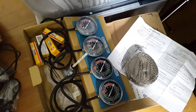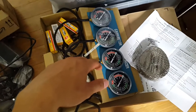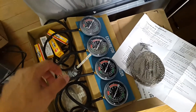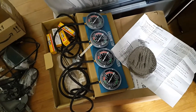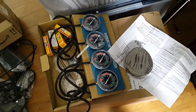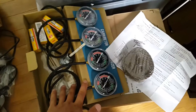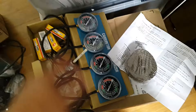In the last video, my bike started for the first time and I was pretty excited that the bike was idling okay, but when I gave it gas the bike would kind of die out. So I started looking online why this was happening and how to fix it. Some people said it has to do with the jets, but I do remember rejetting my bike to accommodate for the 4-to-1 exhaust and the intake box I removed, so I didn't want to play with the jets just yet. I kept looking and it turns out my carburetor may not be synced, and this could be causing the bike to die out.